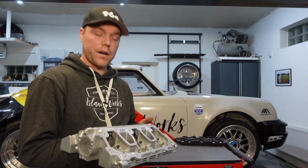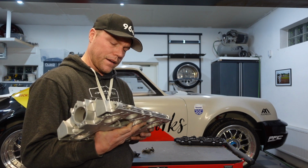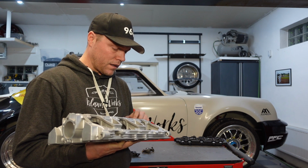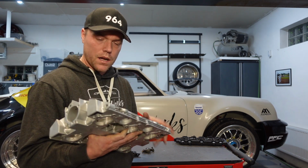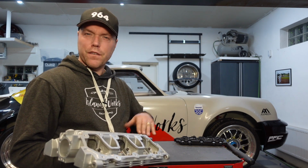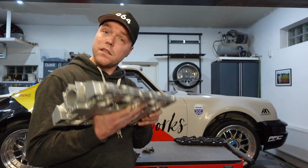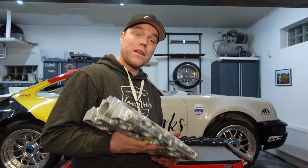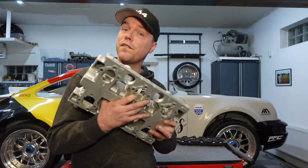Making sure that you really have perfect lubrication through there. I think this is honestly not only related to the lubrication of the shafts, because they did have hydraulic lifters on the 993, which I will not have. I will have mechanical lifters. And I think that oil channel concept had something to do with pushing oil down to the hydraulic lifters. But anyway, it's a better oil concept and something that I really like. So 993 cam housings make a perfect Frankenstein baby and are the right thing for my build.